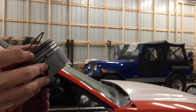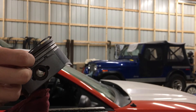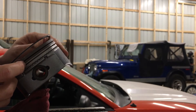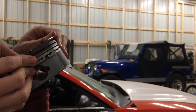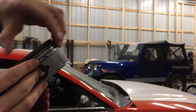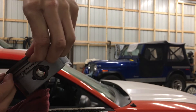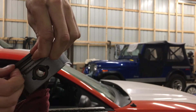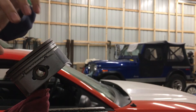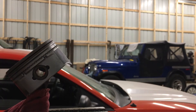On the second ring I'll normally get my gap facing six o'clock pointing straight down, with the letter E facing up. I'll just slowly work it around the piston. She'll pop right down on there — though of course the top one sometimes pops into the top groove, which is annoying. You do want to be quite easy with that second ring, especially if it's not a stainless ring, because it's very easy to break. I've seen it happen many times.